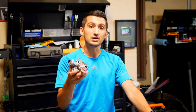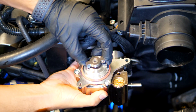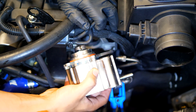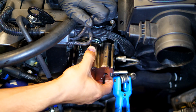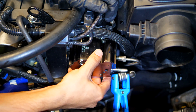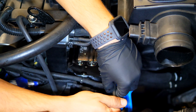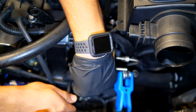It makes the most sense in this case to buy an OEM Mini piece. As for the actual install, it's the exact same reversal of the disassembly. Sliding the new high pressure fuel pump on, this little tab here needs to align itself into the camshaft found inside there — this might be a little tricky, but if you just slide it down into place you should be able to push it on. You might have to clock it a little bit to get it on right, but it shouldn't be too difficult. It just slid in — that's now in place. Grab those three Torx bolts we removed earlier and secure them into the cylinder head. After all three are hand tight, grab your torque wrench and torque each one to 8.1 foot pounds.